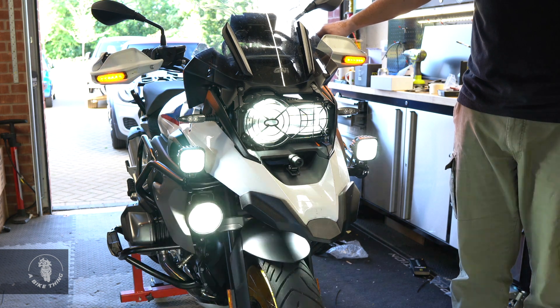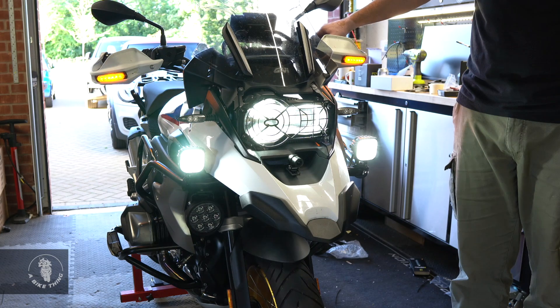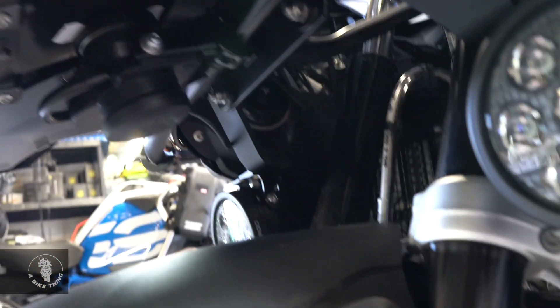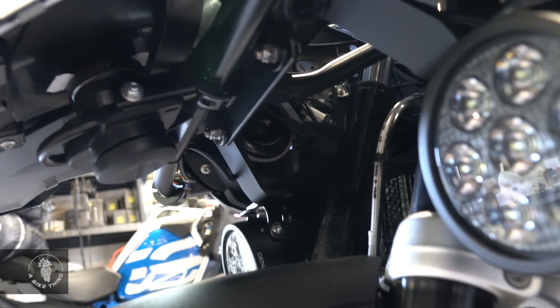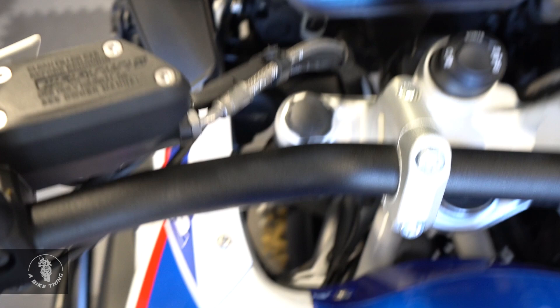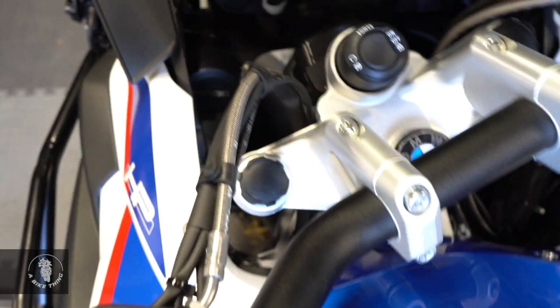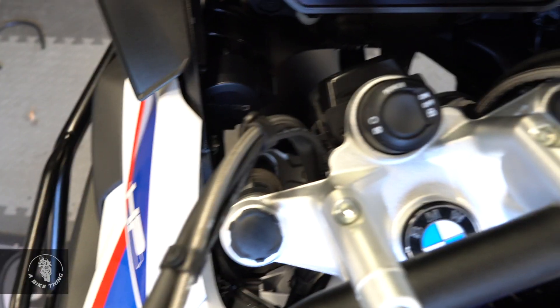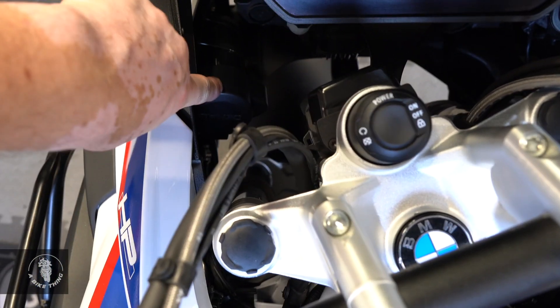And then full beam and strobe. With the sound bomb, we've used a crash bar horn mount - it's a split sound bomb, so that's the horn part there in the center of the screen. The compressor side we've decided to mount just near the handlebars - if I turn the steering you can just about see the compressor down here.